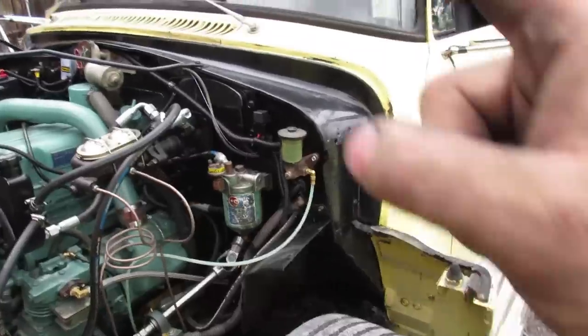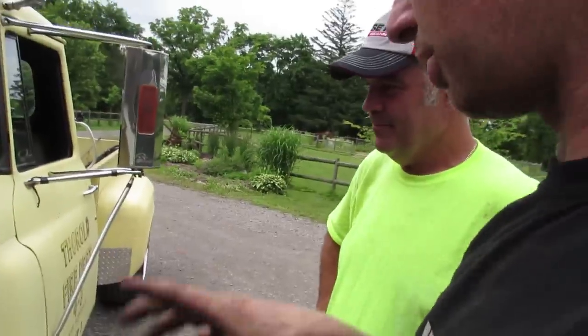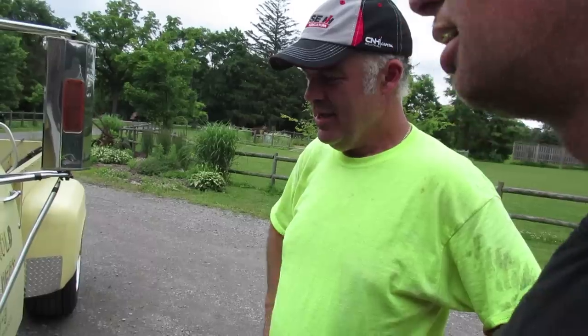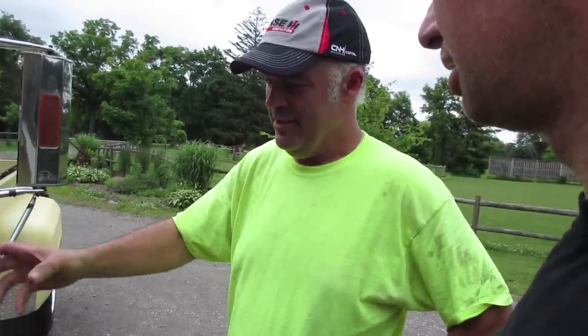You bought it with the engine and the transmission attached already? Yes, a complete setup. So he set it up for you? Yeah, apparently the tranny's from a C70 or a C60, about a 71, 72 four-speed. And there's an adapter plate because the flywheel housing is SAE 1 or 2, I'm not exactly sure, just basically surround. And then there's a coupler that goes from the back of the crankshaft to the splines on the front of the transmission inside the clutch.